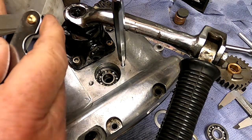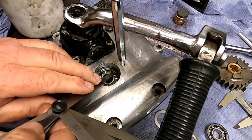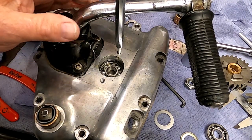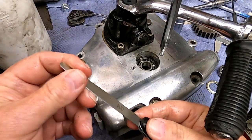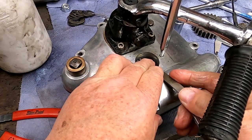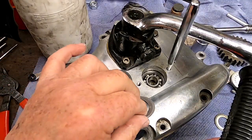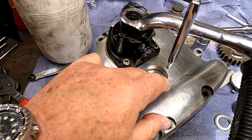15,000. This is the dodgy feeler gauge where certainly some of the blades on it seem to be a little bit ropey. Well, I've just tried an 18 that went in. Now I've got a 10, a 6 and a 4. That's 20. So let me just see if that will go in. No, that won't go. No. Okay, let me just go back to an 18. Right, here we go again. I've been very fortunate with the shims I had in stock. This gives a thou clearance, which is fine.